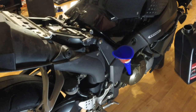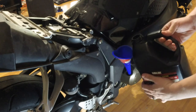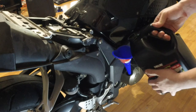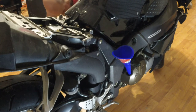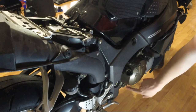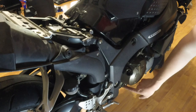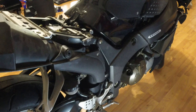Like with every oil change, slow and steady — it's going to take a little bit of time. And don't worry that this says Yamalube — it's all the same oil, just whatever brand is on the jug. It's also the only thing the dealer had when I went there. It's always a good idea when you're filling your oil to check periodically just to make sure you're not getting any leaks around your drain plug or around your oil filter. Everything looks pretty good so far. She's all filled up. Make sure you check your sight glass down here and make sure your oil level is between your two notch marks. Make sure you're not overfilling it because that's a giant pain — you've got to get a whole syringe thing and suck the oil back out. But everything looks straight on here and I haven't seen any leaks.